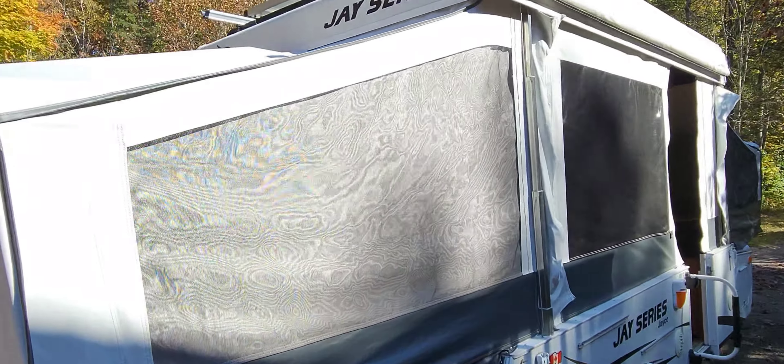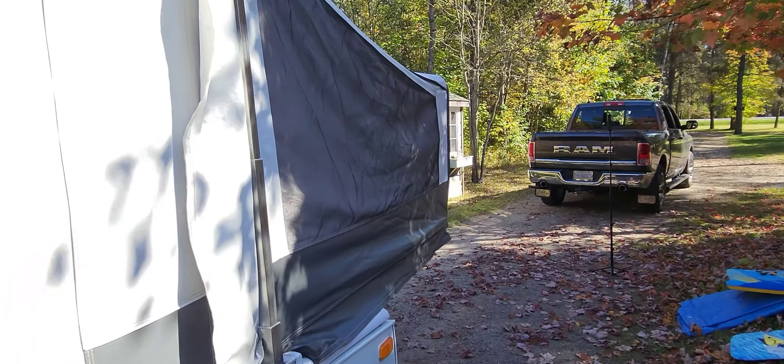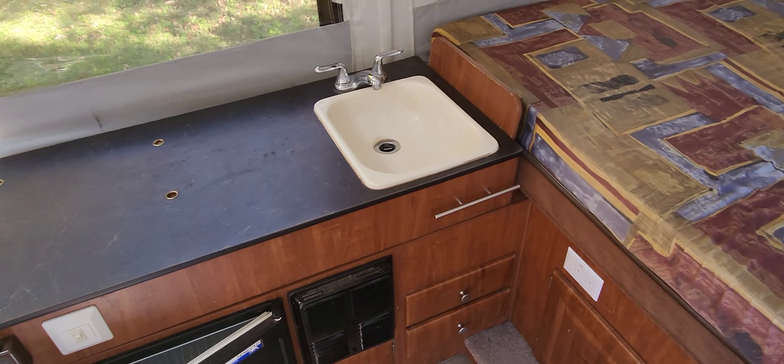The trailer is completely dry now — it's been an absolutely beautiful day. I'm just going to check the front here — make sure it's dry. Yep, we're good. You want to make sure it's completely dry or it's just going to go all moldy on you. I'm going to start loading the trailer up with stuff I have to store inside. One other thing you've got to do when winterizing: if you have one of these little fridges, just leave it open a crack. I have my crank thingy holding the fridge door open. So I'm going to start closing this thing up and get ready for the final procedure.